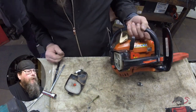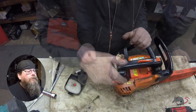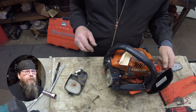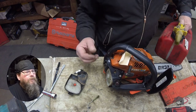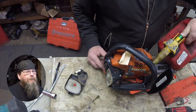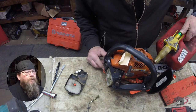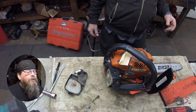I'm thinking that fuel filter, the way it was glazed over like that, may have been part of his problem if he had tried to start this thing and it wasn't running for him. This was one of those deals where the guy was already whining about the cost of a repair when he dropped it off. So we're just doing a quickie once-over on this thing, and if it runs, we're gonna send it.